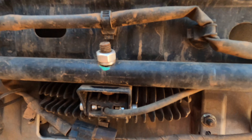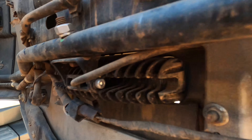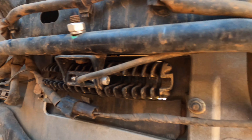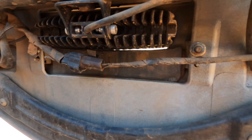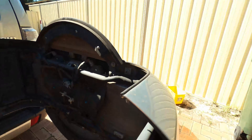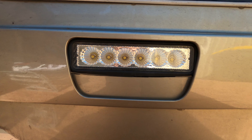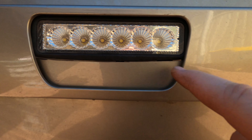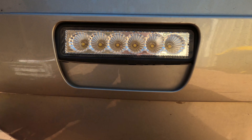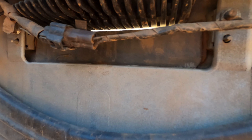All I did was drill a hole, get a little 10mm bolt, drilled a hole through this at just the right angle — it is at a little bit of an angle just to get the light into the right position. Just bolted it straight through. I've gone and cut the original plug — that's the original plug from the fog light — and just soldered it in there to make sure it's nice, and that sits neatly up there. On the outside you can see it just fits nicely in that spot. I had, actually from my bull bar install, a little bit of one of the old flares left over. All I did was cut a piece out of that — you could cover it with any bit of black plastic or colour code it if you want, but it's just what I had lying around. There's a little section about this thin, and you can actually just sit something down in there so it sits and stays real easy.